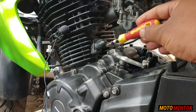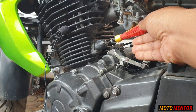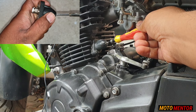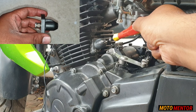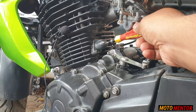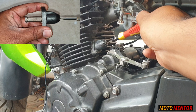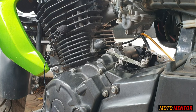Let me first tell you the process of what you have to do. First, you have to take a flat screwdriver — as you can see in the reference footage — and turn it clockwise. After this, the chain tensioner push rod runs back, and after that you release it. You will hear a noise as the chain tensioner releases and the chain guide becomes tight.